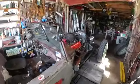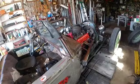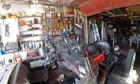One of the things I love about this engine is the way it starts and runs. It has a crispness. That's a term people use talking about banjos sometimes. It has a crisp sound. And I believe it probably has to do with the compression ratio. These old flat top pistons put out a pretty high compression ratio compared to what happened in the 70s.